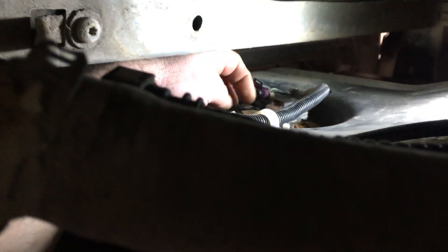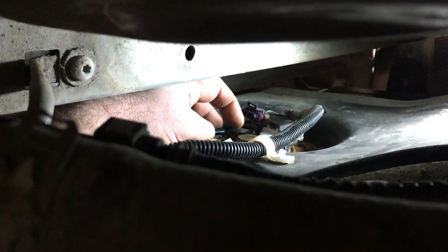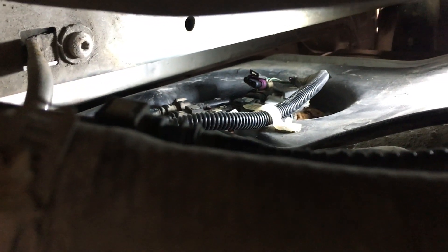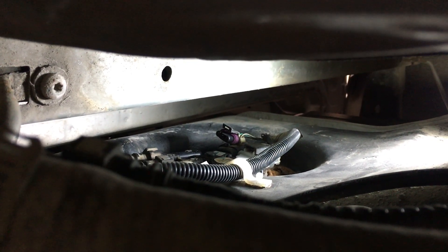I was watching online and there's a fellow who says when you try and lever this out, sometimes the little nozzle gets stuck and breaks off in there. If it does, just get a coarse thread screw, get in there, screw it into the broken piece to grab the threads, and pull it up and out. He says if it still doesn't come out, you can push it down and leave it in the tank — it's big enough that it will never get sucked up by the fuel filter and never cause a clog.